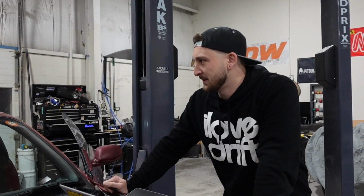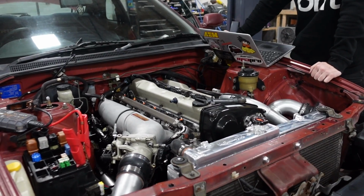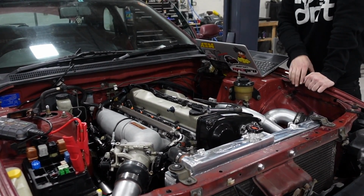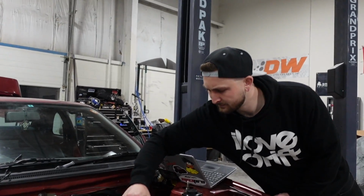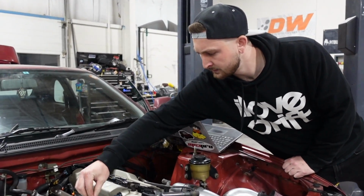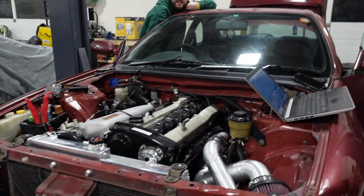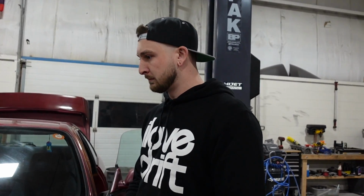Should we just do it again and see what happens? Crank it. Yeah, just be ready to kill it. Ready? Yep. That doesn't sound good. Did we lose maybe an injector pulse? No, that's like internally. That was just straight misfire. Bro, what is that? I think it's just the VTC gear being a butthole. I think it's the VTC gear.